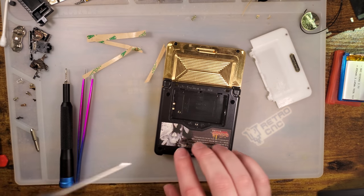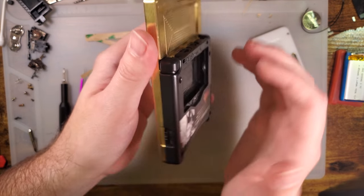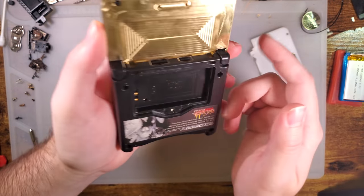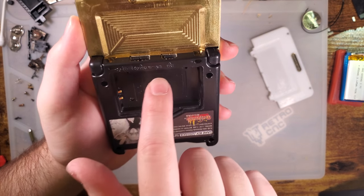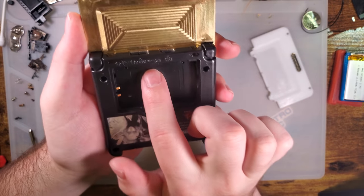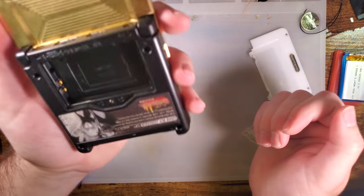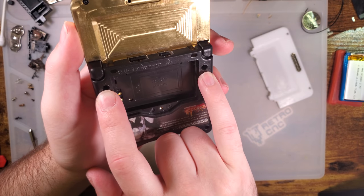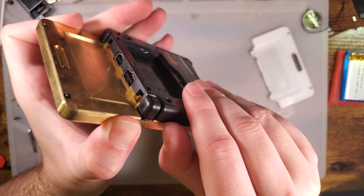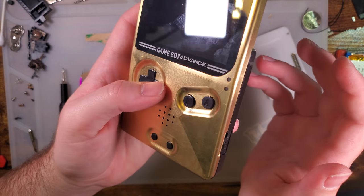All right. If you did not use those 3D printed brackets, you're done. Pop the battery in, throw the battery cover on, Bob's your uncle. If you did, however, well, if you didn't, you might notice three empty screw posts. This battery screw post is always going to be empty no matter what. There's just no way to work that into the design easily, and even if you did, it doesn't make a difference. This thing is so stiff, it's not going anywhere. These two on the edges, however, in some aftermarket shells, the tolerances are not as good as OEM shells, and you might get a little bit of flex with the aluminum, and if you're so lucky, brass.